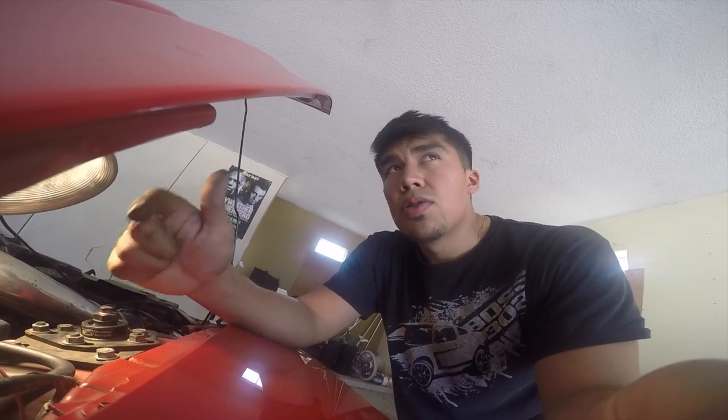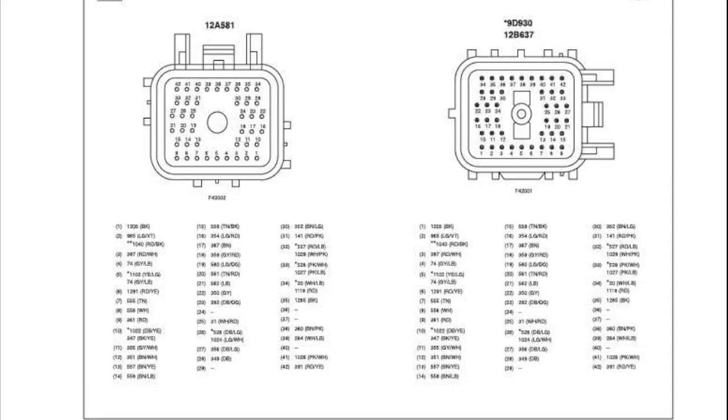I also found another image of the pin diagram layout, and if you guys are wondering what this is called, it's called C133 connector. So that's pretty much what it is. And when I pulled it up on a forum for my car, it did show like 2 color options for that specific wire, and what that wire does is it goes to the coils. So I'll put the picture in the description. I'll put a picture for the computer layout and the C133 connector layout.